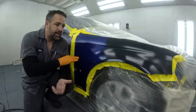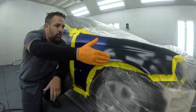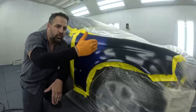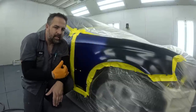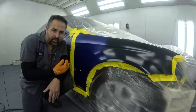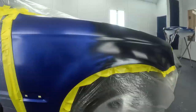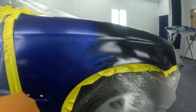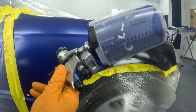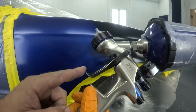We're going to use a reverse blend technique. Basically, we go all the way to the furthest point of where our blend would be and then work in steps moving toward the front of the fender. This helps in smaller areas because we're not consistently pushing the blend closer to the tape area. When doing a reverse blend, I'll never move the paint gun all the way across — I always work at a diagonal, which keeps overspray away from that area.